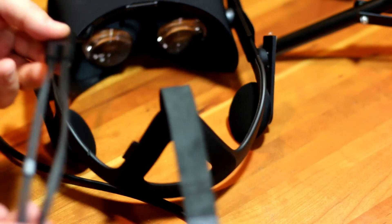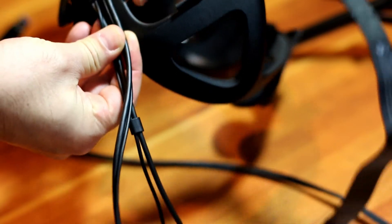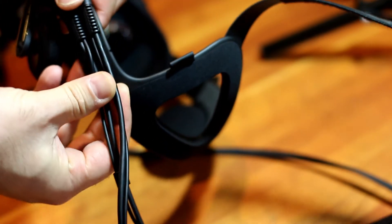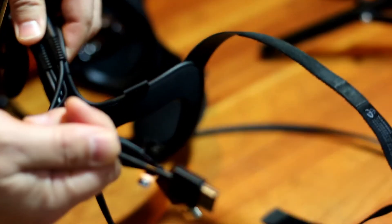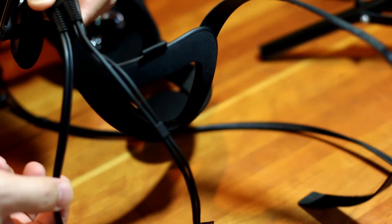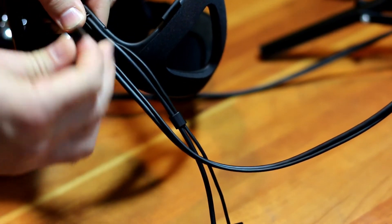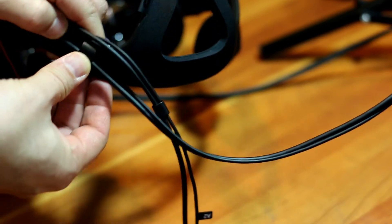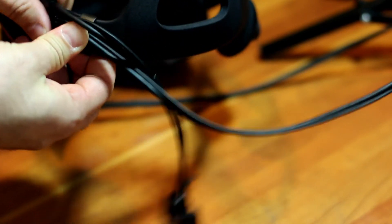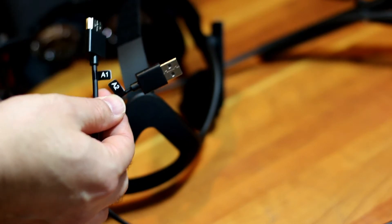The TP-Cast cables are a little thicker and longer than the original, so leave a little slack toward the back of the headset. There's a groove at the back where the clip should go. Orient the cable so the A1 and A2 cables are facing up and the longer cable faces down, since that goes down to the hip pack battery. Once oriented, take the clip, put it around the cables — you can actually just clip the cable going to the battery pack, not the ones going up to the headpiece, to give it more freedom of movement.